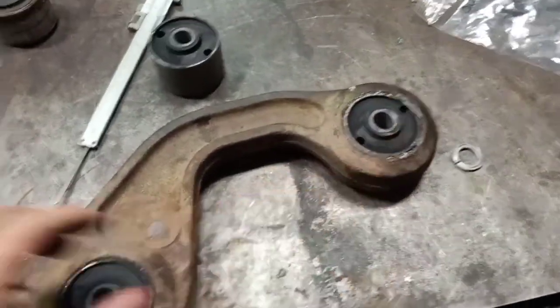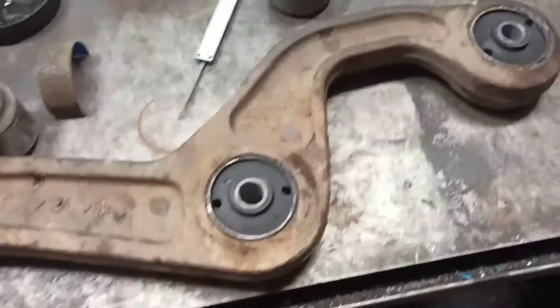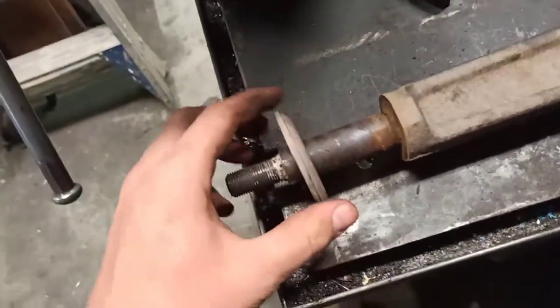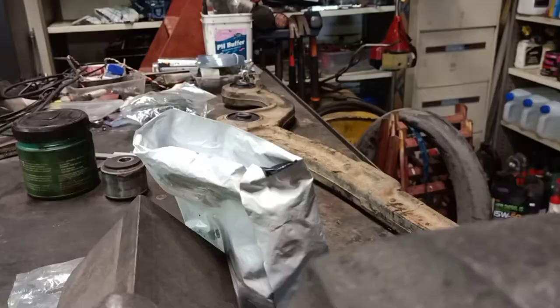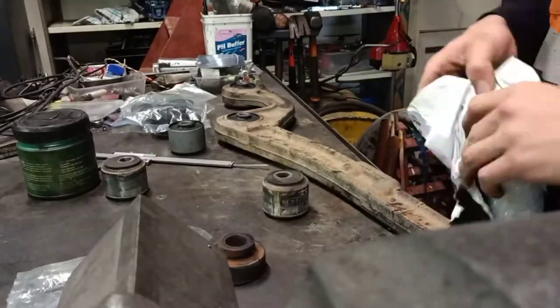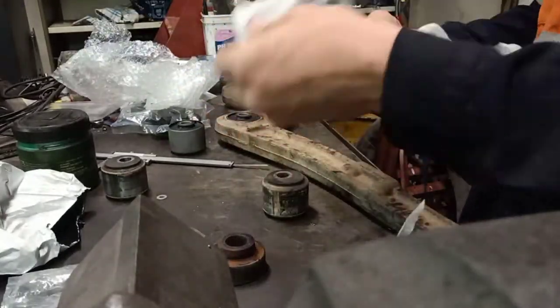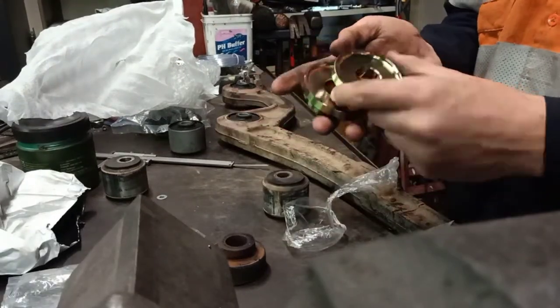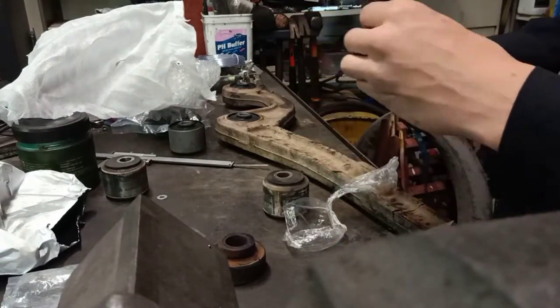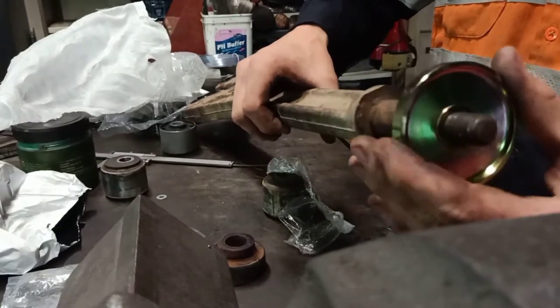Both bushes in, looking alright. I'm not too sure about the alignment of the holes — I don't think it means much, might help with them flexing. I'll clean up the arm a little bit with some emery paper just to get the surface rust off, and the spacer goes in there. These are the spacers — not much to them, there's one for each side. This bush here slides under the end of the arm to give a bit more room, then the spacer slides over there and up to that shoulder.